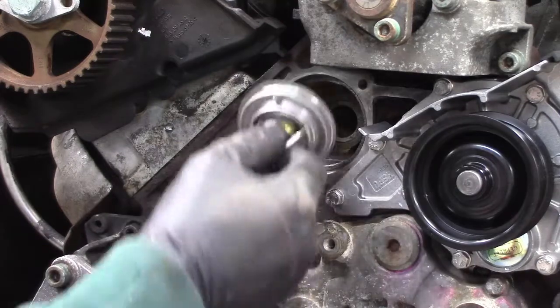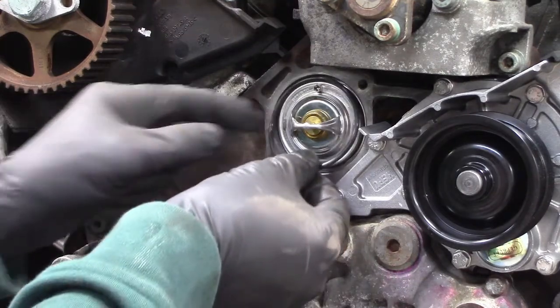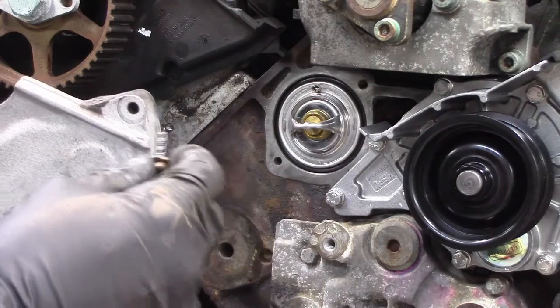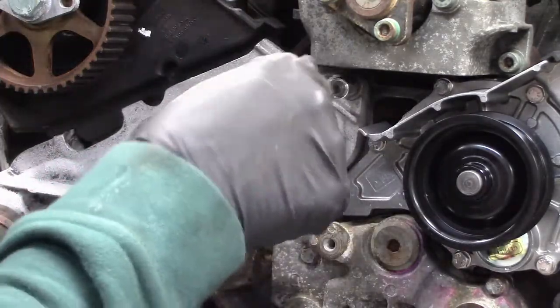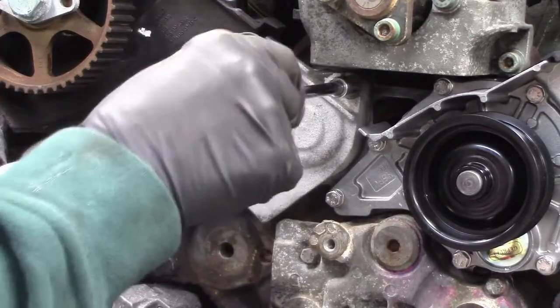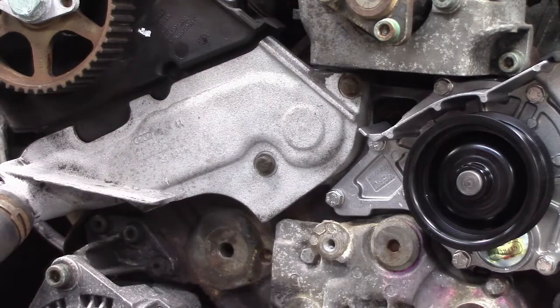Slide it right in that direction. Bleeder at the 12 o'clock top position. O-ring goes in right over that. And then the housing. Kind of give it a little jiggle and make sure it's in position as you're tightening it in. Now it's going to squish against that O-ring quite a bit. And that O-ring, that's what's going to give us our waterproof seal.